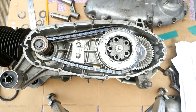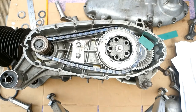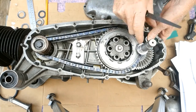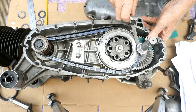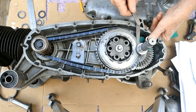That is the best case scenario. If I put 2mm of packing here to represent the 1.6mm clearance and the 0.5mm gasket — this is still a GP shaft, I've taken quite a lot off here, and took the nib off as well, probably unnecessarily. The reference pin location is marked. If I press down hard to try and keep it straight, I have 0.5mm clearance. If you were to look in and look horizontally along the line of the feeler gauge, you will see the daylight.